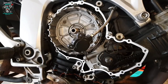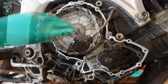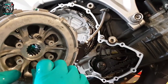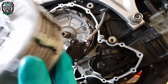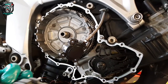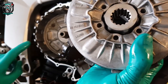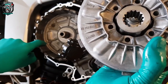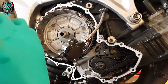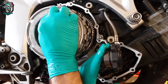A bit of oil on that — thrust washer. Screw a couple of those Allen bolts in this rear piece just so you've got hold of it. The tongues with the writing on that we were looking at on the bench — one of the slots in the basket is slightly smaller, and that's the one they've got to go into. So you have to have a bit of a fight, but as long as you're patient it should all just slot together.